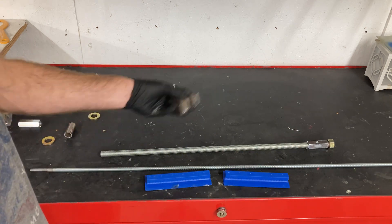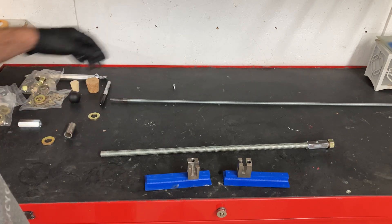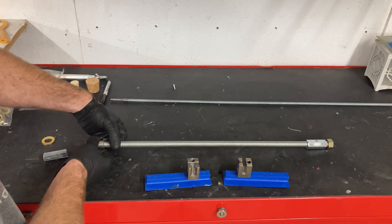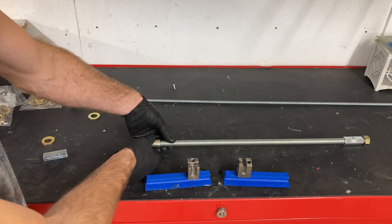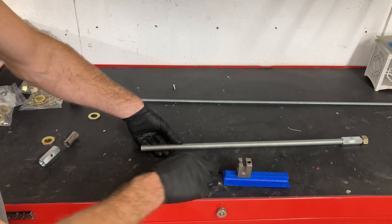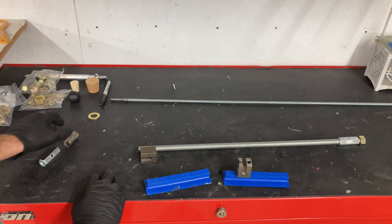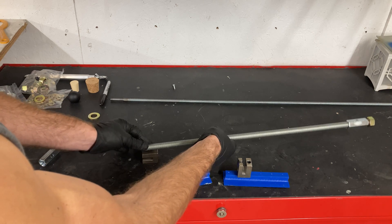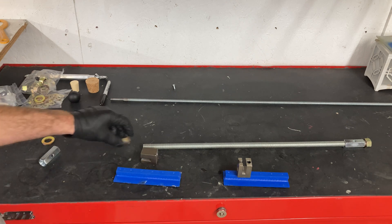From Kiko I'm using the feet tabs and the boots which go on the rod. I've just cut up a little piece of pipe — I'm not sure exactly what size it is, but it fits in here pretty good. Ideally I would want to put a bearing here and weld the foot to a bearing — that would be much better — but I couldn't find a bearing that wasn't so long it would make this stand up too tall. You want the rod as close to the panel as possible, otherwise the feet are gonna dig into the panel and cause issues.